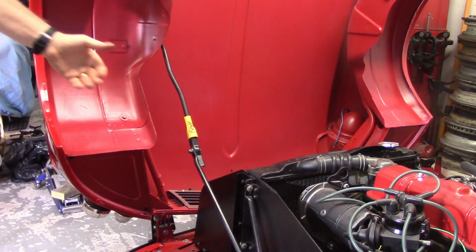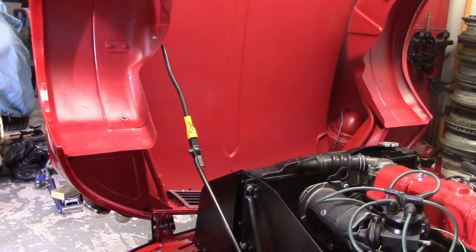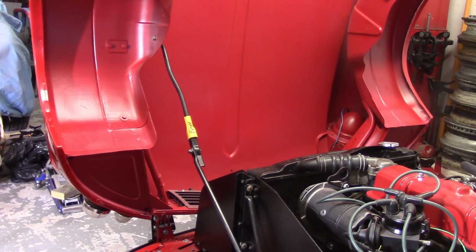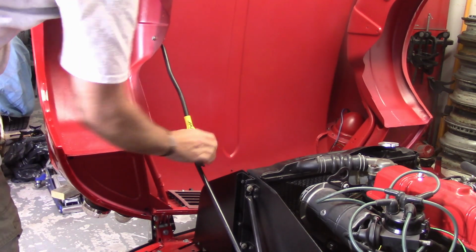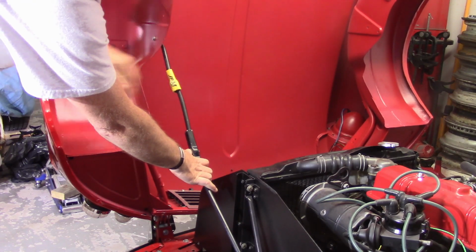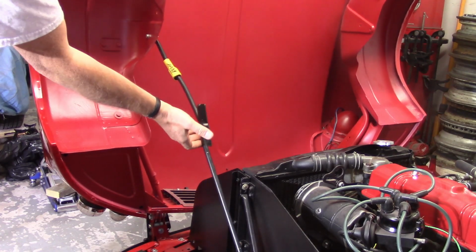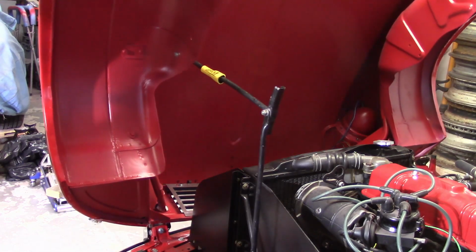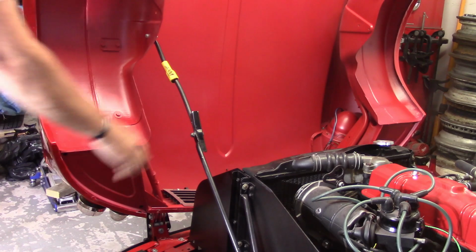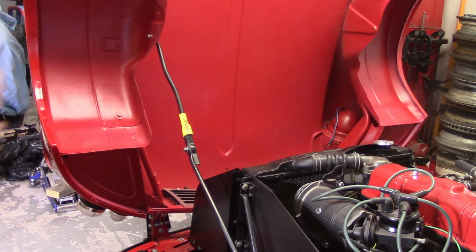So again, all it does is really cover the two and essentially connect them, and now you can't get the bonnet apart or the prop rod to articulate and to come down on your melon. When you're done, at least for me, I got to press down a little bit to kind of loosen the tension, and now that's loose. You can slide it all the way up to where it gets into the curvature, so it kind of holds there a little bit, and then just let the prop rod down, and the slide lock will sit there. So again, press down, at least for me, take the slide lock, put it down, and that's it.